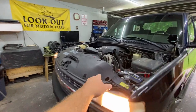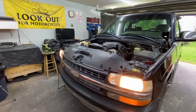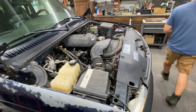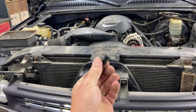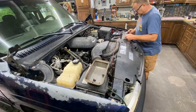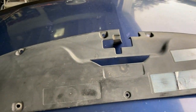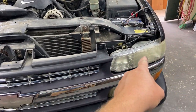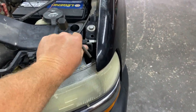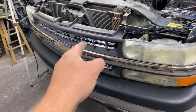I think we're going to start with the clips on this thing, get this shroud off and maybe start working towards the lights in the grille and see where that gets us. Nice and easy — you just have these little clips, you pop up the middle button here and then the whole clip will pop out once you get that middle button up. Next we're going to work on these lights, which I'm pretty sure you just have these rods here that come out and that will allow you to pull the light out and unclip it.